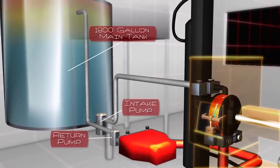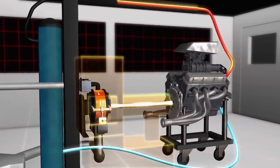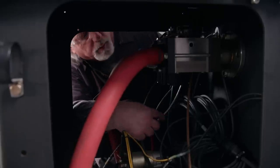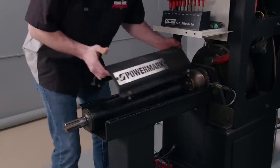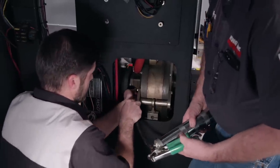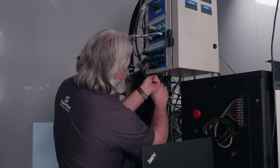The hot water gets pumped back to the main storage tank for reuse. While most of the dyno's water is used to absorb torque, some of it regulates engine temperature, making for an accurate, efficient, and consistent dyno test system. The Powermark absorber is a twin rotor design that also uses an inlet and an outlet valve. The advantage is that if you're going to test over a very wide range of RPM, you can adjust for that — running an engine from 2,000 to 8,000 RPM if you wanted to. The capacity of the absorber is substantial; people are testing engines at 3,000 horsepower or so with that kind of brake.